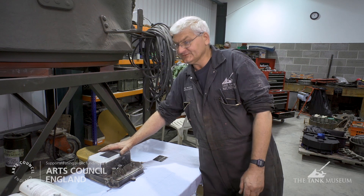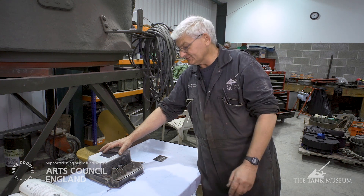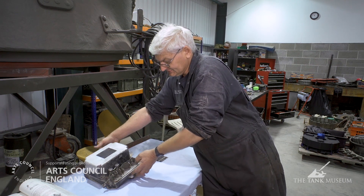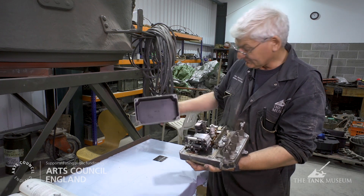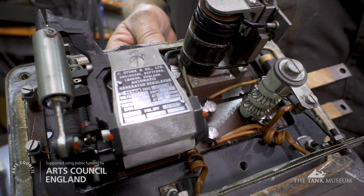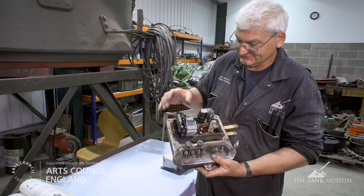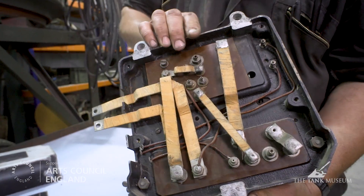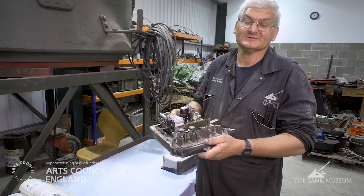This is another of the electrical accessories which we're only just starting to look at — it hasn't had a lot of work done to it yet. It's one of the control boards that goes with the generator or dynamo, and it controls the output of the dynamo while it's charging the batteries. As you can see, it's basically in the state in which we took it out of the vehicle. Internally, apart from a little bit of mould on one of the windings, we'll clean that up and re-varnish it. This is an automatic regulator — would have been high-tech for its time back in the 1930s, very old hat now. It uses a carbon pile and a regulator. The rear is in pretty good condition. We'll put all that back in and make it function in the vehicle so we've got the historical accuracy.